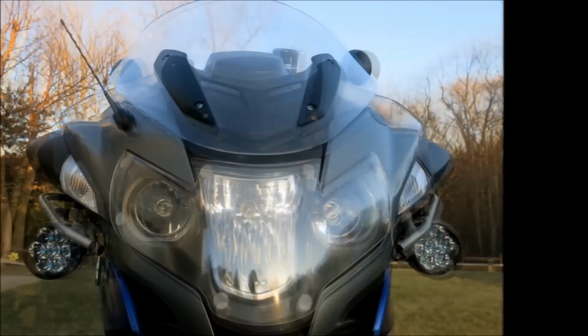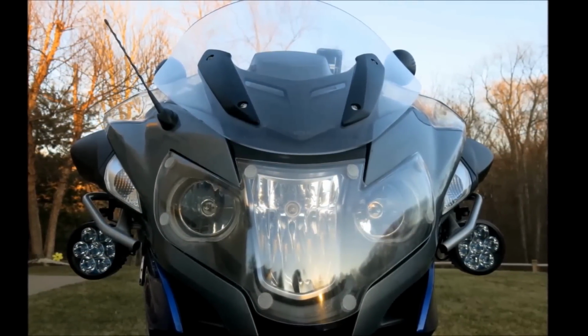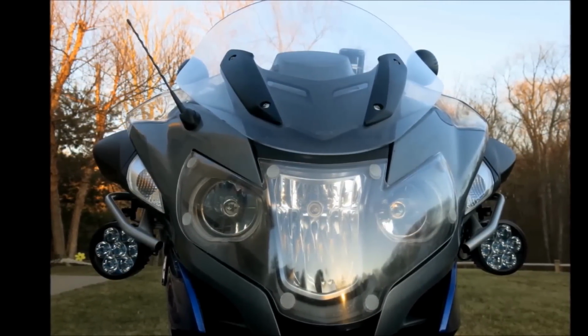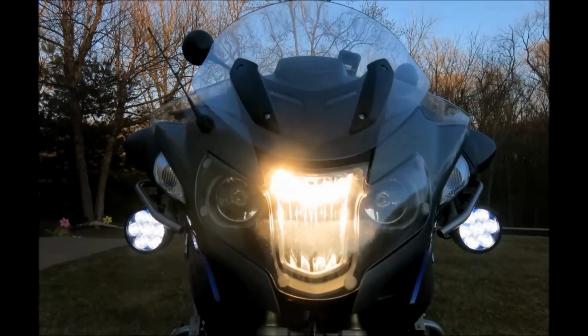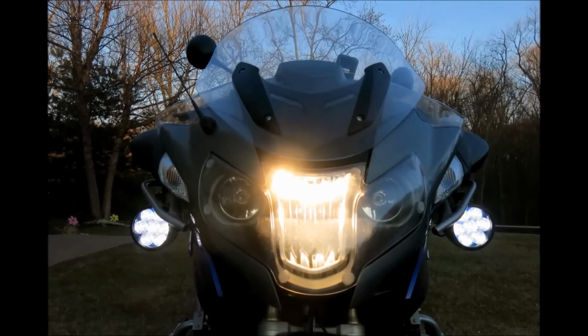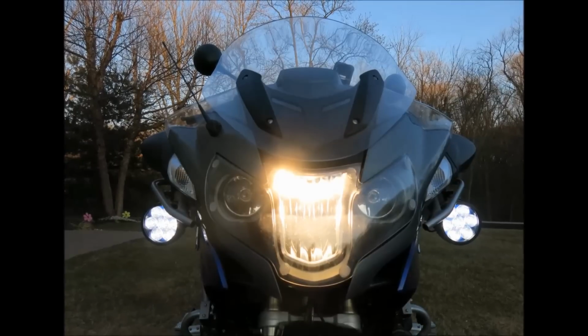The right side has the more extreme angle outward, so that I can see everything by the side of the road for what seems like miles ahead, especially deer. The reach is phenomenal, and the crisp 6300K color lights up reflective signs, roadside animals, and everything else, like the noontime sun. Let's go to some night testing.